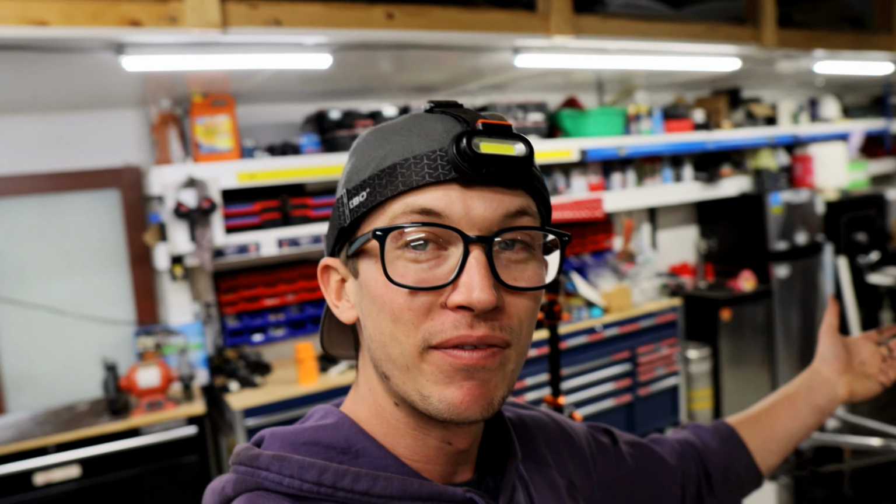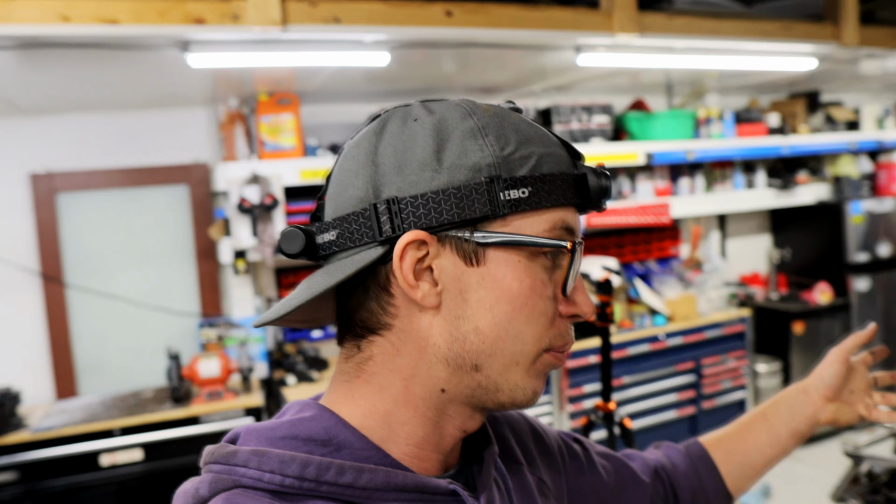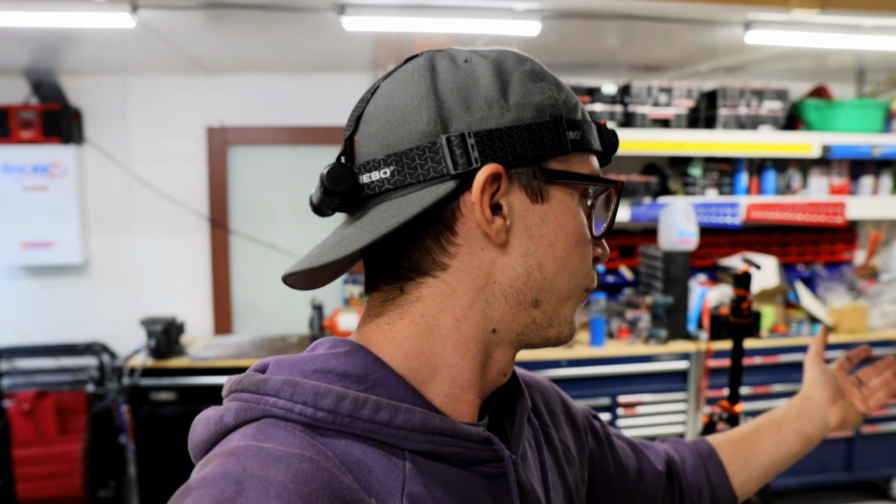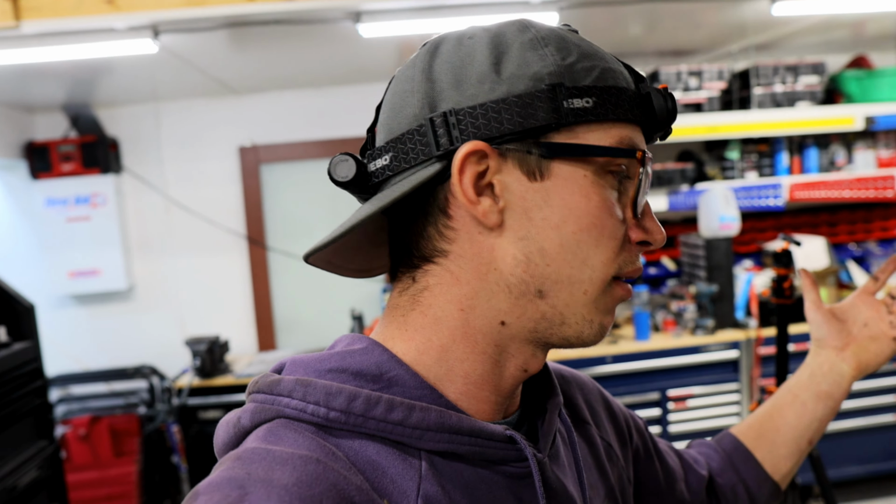We're still gonna need the 750cc injectors to tune it, because I think it has like 260s in it, whatever factory D21 is. So that'll need to be changed. It'll idle on those just fine, but we won't be able to get into boost at all.